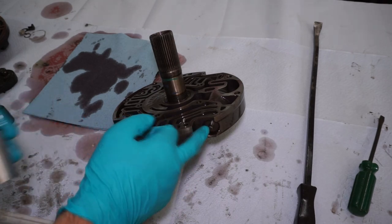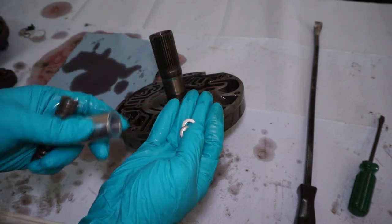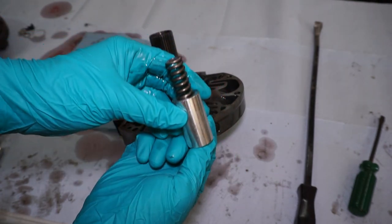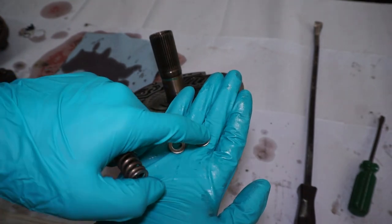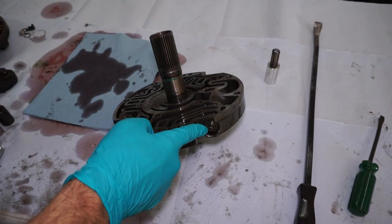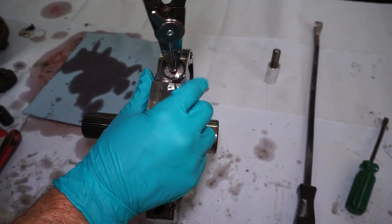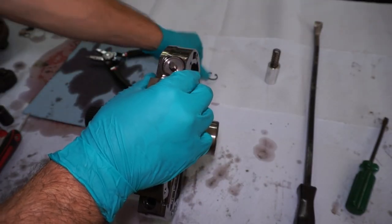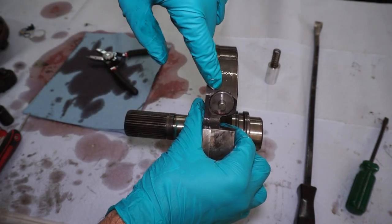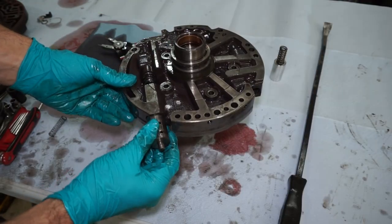While we're already working on the pump, I'm going to take the boost valve out. The trans brake kit comes with the new boost valve sleeve, a spring, and multiple washers. The washers are going to be used to shim the spring to add line pressure — base pressure with this spring is going to be 150 psi, and each shim should add 15 psi. So we're going to add two shims underneath the spring, then take the factory boost valve sleeve and springs out. This just has a snap ring. Sometimes they come out real easy; sometimes it's a little dented around here, so it comes out kind of hard. I had to grab on the end of it with pliers and tap it out.